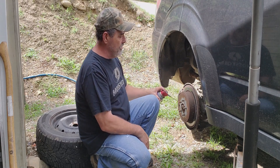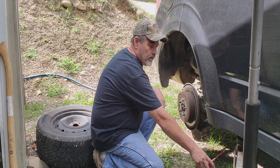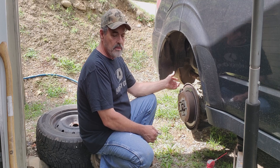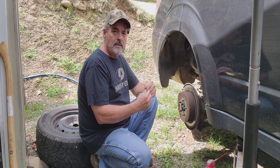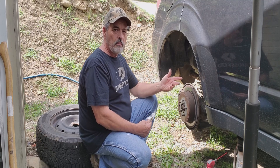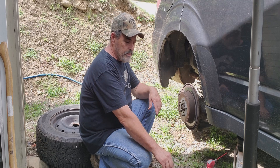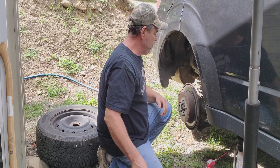I'll put a little WD-40 on it and see if that'll help loosen it up by the time I get these other bolts off. This piece here in the back is the caliper bracket that holds the caliper. Somebody went in and stripped them out - I didn't do this, I've had it for a few years but it was like that when I bought it as a used car. I went ahead and ordered new bolts, I think about five dollars a piece, but it's worth getting them new. I'll put anti-seize on all this stuff.